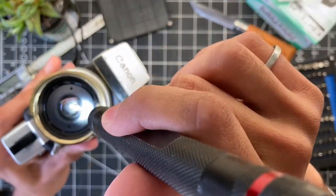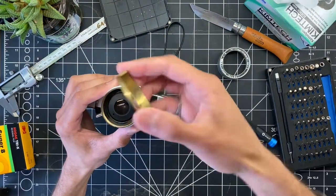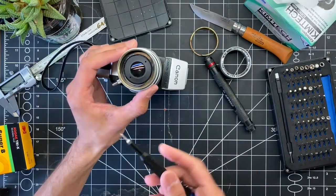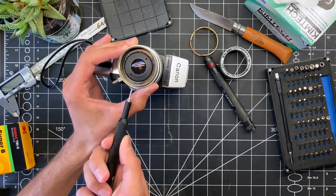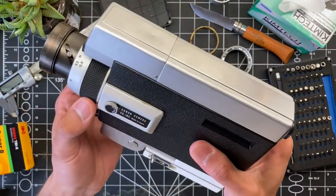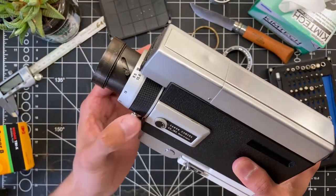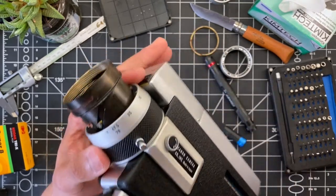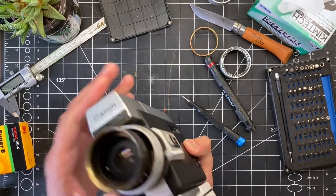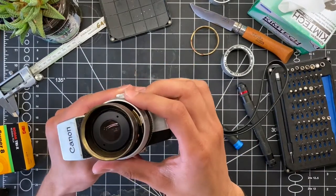This inner lens doesn't look too dirty, but I'll try to get it out as well. There was one more sheath around the lens so I removed that too. With that off you can actually see the zooming feature — as the zoom ring turns, you see the lens moving on this cam slot, which is a very unique and complicated way to move the lens. Back in the day this must have been really expensive to manufacture or assemble. Now I'm going to try to get this inner lens out.